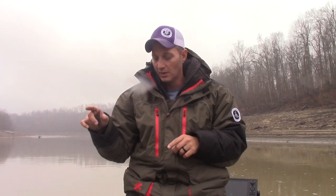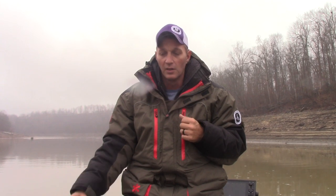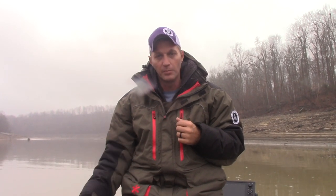I went to my black box — no light whatsoever. I didn't have an ohm meter to check battery voltage, but I knew it was good. So I unplugged the power cable, left it open for 10 seconds, plugged it back in, and got a blink of red light then nothing — so I knew I was getting power to the unit. I had already swapped out my fuse since I keep an extra one. I knew the head unit was not telling the black box to come on, so I unplugged the networking cable at the black box, waited 10 seconds, plugged it back in — nothing.